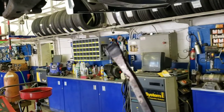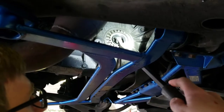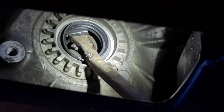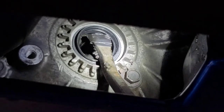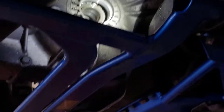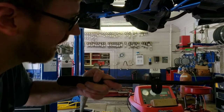I could not find a single video on axle seals on the Subaru — it's super easy. I've seen people take out the bearing preload adjusters and all that, but you don't need to do any of that. Get yourself a pry bar, put some tape over the end so you don't scratch anything, stick it up in there, find where the seal is, and gently pry it out. That one's in there good — this is definitely original. The other one came out so much easier. That simple — just pop it out.